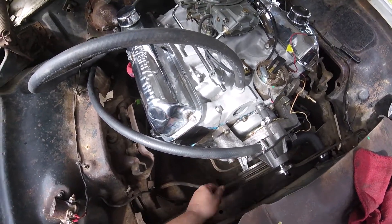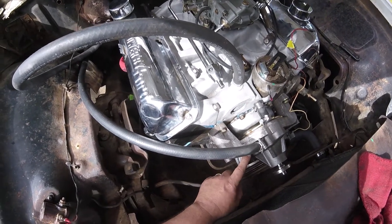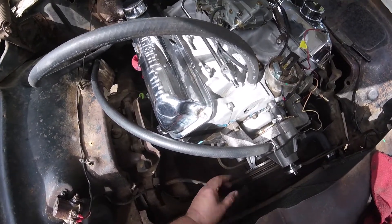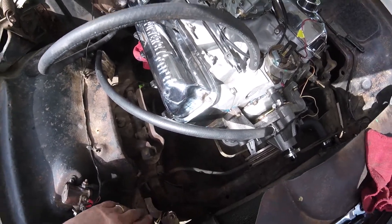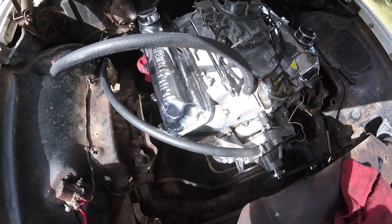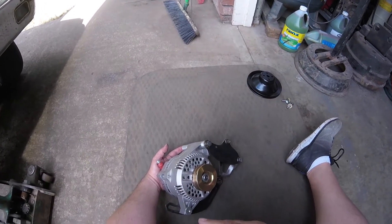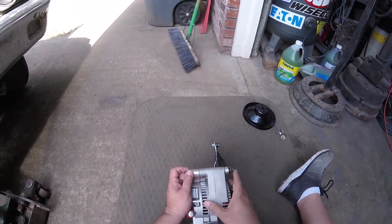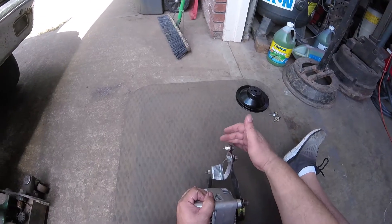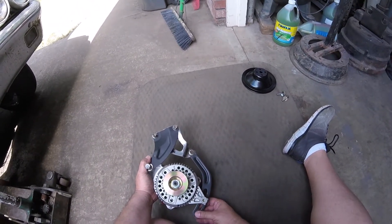One saving grace is the block already had the hole drilled from the factory — it's a late '62 piece. With the water pump you've got to be careful: this is a '62–'63–'64 water pump, so it's got the dowel in it. The later units have a bolt hole in there, which is how this would mount as a topside mount. I inverted it to maintain the correct geometry. Here's the factory-style bracket — don't pay attention to the nuts; this nut-and-bolt assembly maintains the integrity of the factory piece for the alternator adjustment.